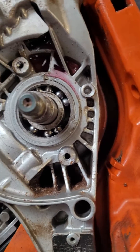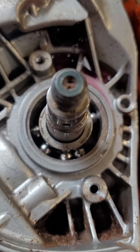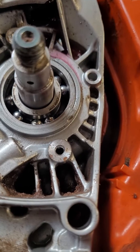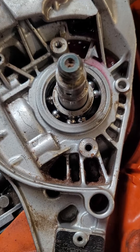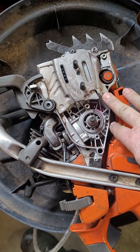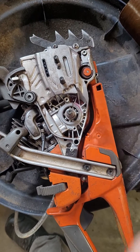The actual width of the bearing race is 11mm instead of 13mm on these, so it needs at least a two millimeter shim. I'll end up talking to the guy and see what he's willing to do on this. One year out of a $300 bottom end is pretty disappointing. Anyways, just beware.